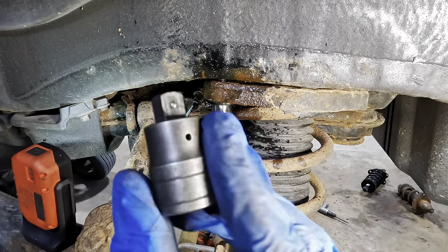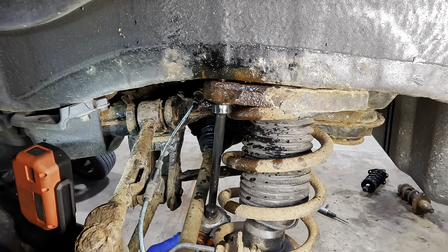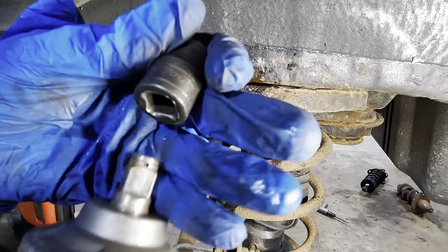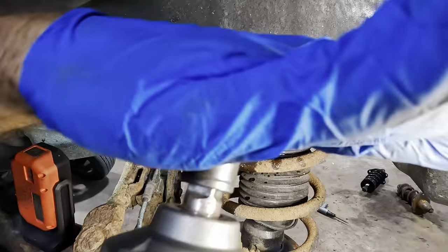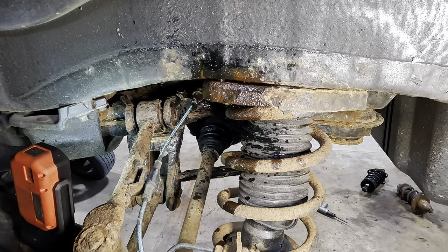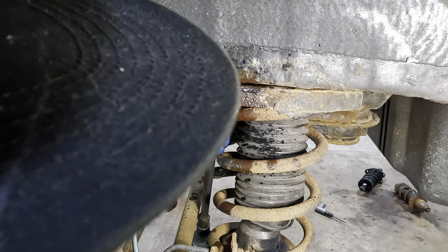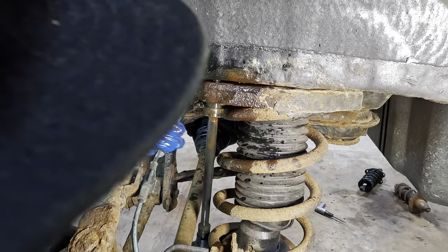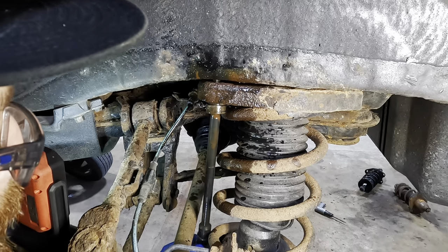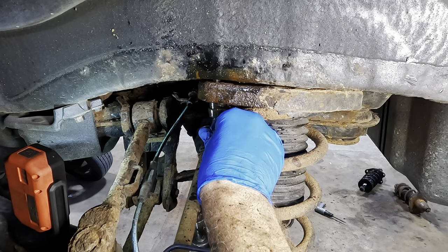Okay, so here's my solution. Got a 1/2 inch to 3/8 adapter. We're gonna put that on the end of our socket extension, and I'll back that thing out with a 1/2 inch gun. It's got more beans. Many more beans. It's got all the beans. Gonna reach? Get on there, you. Why is this side so hard? Now it's all slippery. It's all lubricated and slippery.